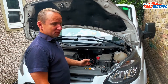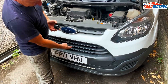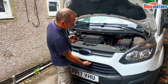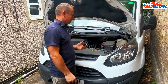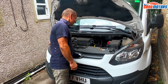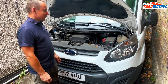Generally, if you have to top up your coolant regularly, that means you have some sort of a leak somewhere. The coolant doesn't just disappear or evaporate — you've got a leak somewhere. Normally it's probably from the radiator. The radiator is exposed to all the elements, so it could be a stone chip, salt from the road, a bird or bug that went through the grille and pierced a hole in the radiator — a tiny little pinprick that causes coolant loss. It only happens when the radiator is active, which is when the engine has warmed up and the thermostat has opened. So with a cold vehicle the radiator isn't working, you start up and can't see the leak — not until the system is pressurised and hot. That's when you can actually physically see the hole or the leakage. Sometimes it's not so easy to find the leak.